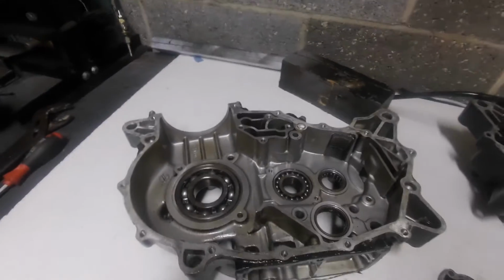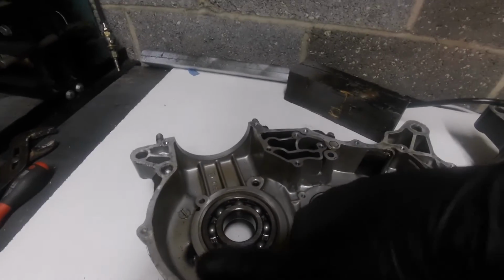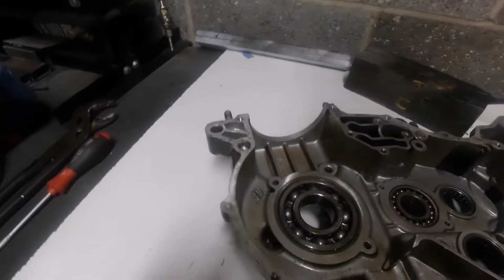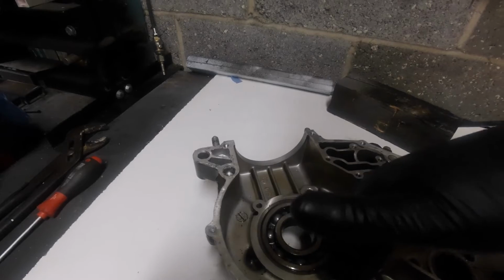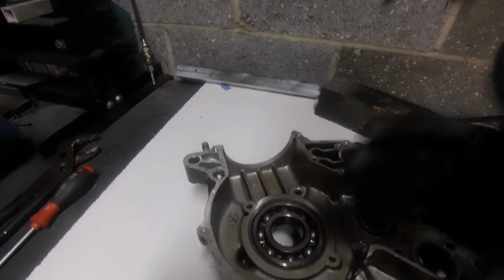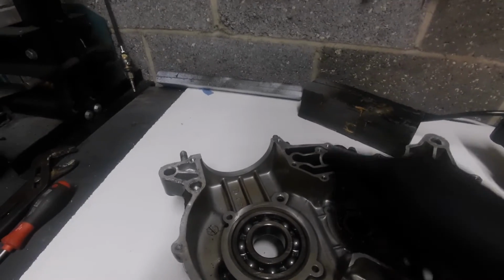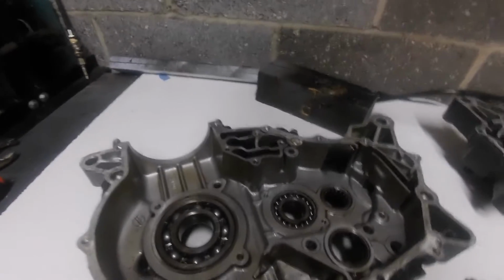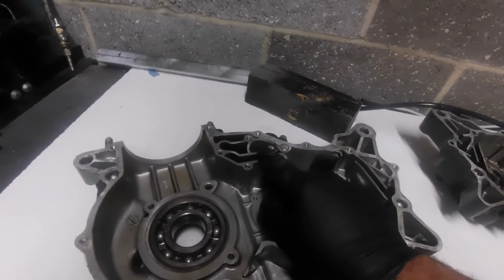The problem, I think, is drawing up oil from in here, as it is so aerated. Remember, we've got a crankshaft. We know the crank's here, so would the crank actually be hitting the oil? I don't know, but properly aerated oil is going up into this chamber here that normally would be going back to the tank. And I know it's aerated because the one that's just gone back, when you start it up, it's like froth when you see it going back into the tank.